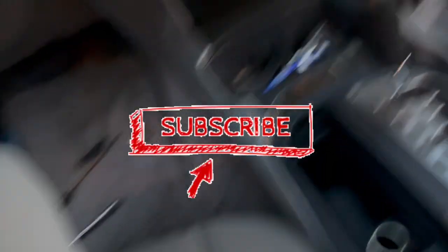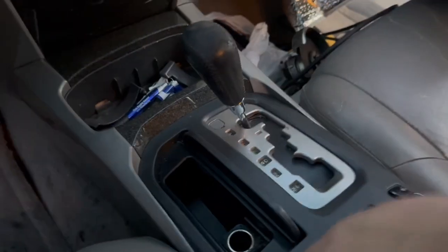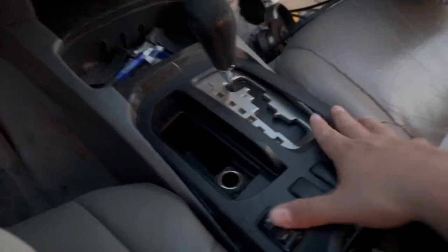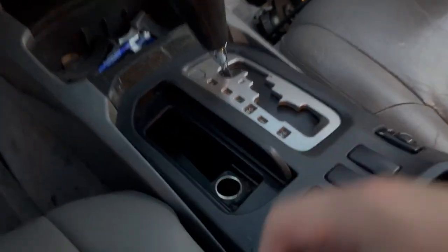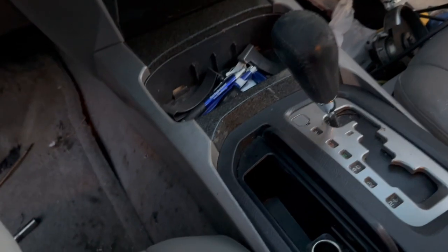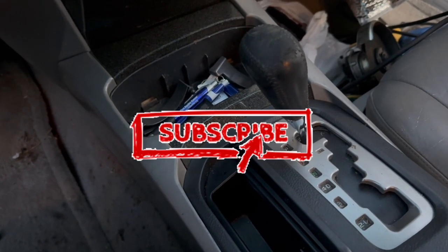Now that everything is snapped back in place, the whole console has been successfully put back together. I hope if you're having problems with your shifter this video was able to help you fix this problem. I know I wasn't able to explain how to take all these off step by step in the beginning, but it's super easy — you open the console, pull this up, start taking this off, unplug the wires, the next one just snaps off, and the last one does have the six bolts. You can definitely get through fixing this yourself and not spend a bunch of money replacing your shifter cable. Hope this video was helpful, thanks for watching — please let me know if you have any questions, feel free to drop a comment, and don't forget to subscribe to my channel for more how-to videos on Toyota 4Runners.